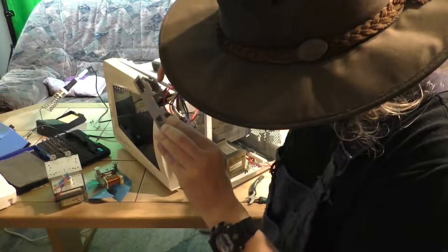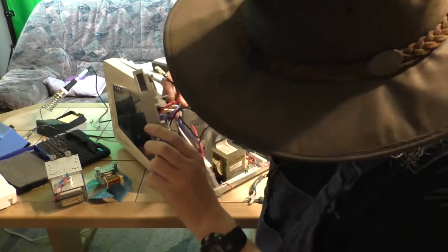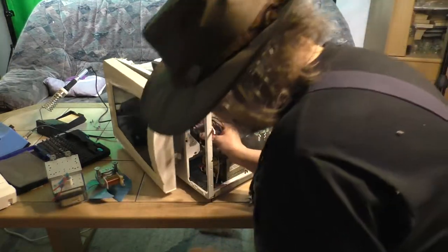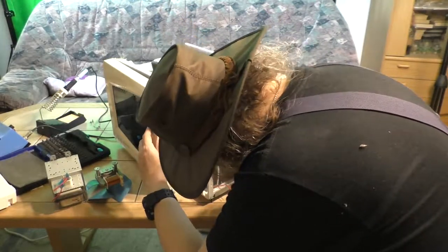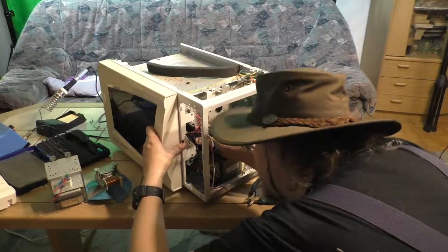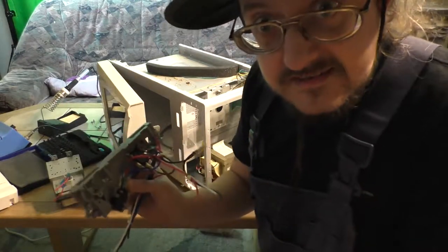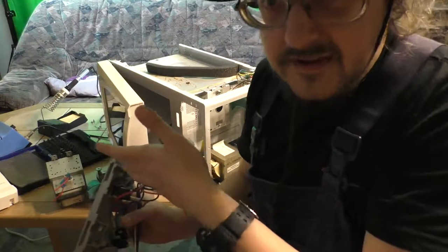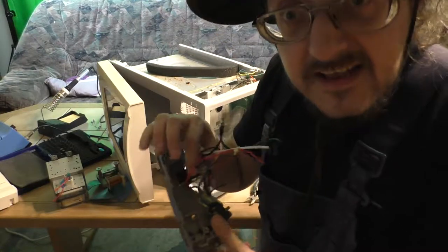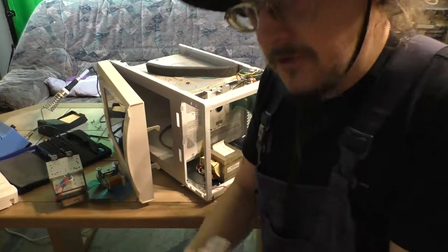Let's see the wiring. Are they okay? They're in series, I think. Let's see. Just try holding it there and closing the door. And okay, yes. Both switches need to be closed. So if one switch fails open, your microwave is toast. If it fails closed, then it would be unsafe, except there is a second switch in series. So unless both of them short circuit,